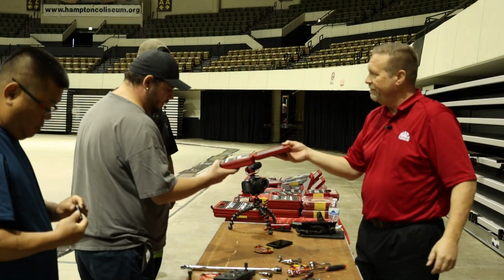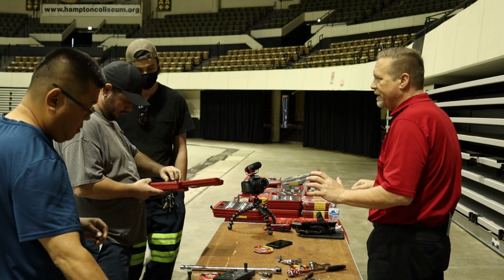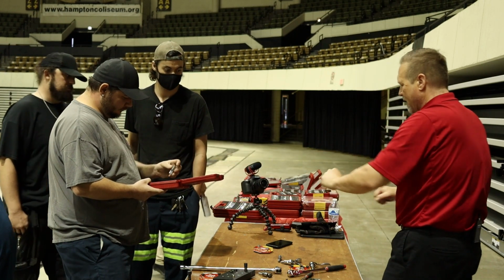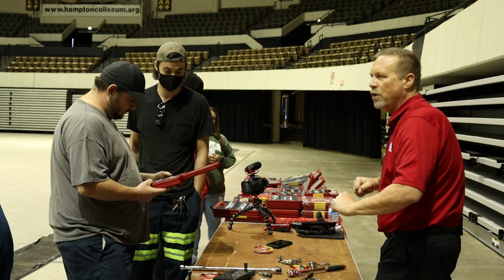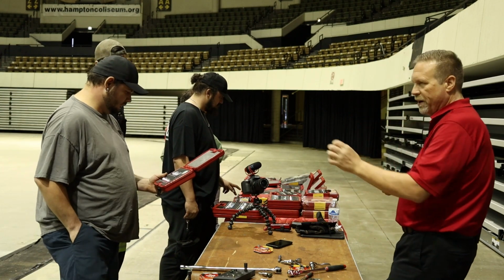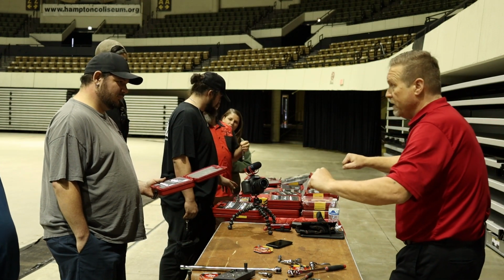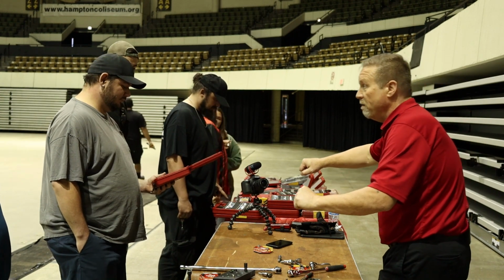Have Torx Plus. In fact, I just did a video of a torque wrench with a torque wrench and a Ford bed bolt, a T50. And I took the torque wrench and a standard conventional one and I stripped it. And I put it in a bench vise and I cranked it until it stripped. I got to 126 foot-pounds before it rounded over. I put another brand new bolt in and got my RBRT one. I got to over 104 and my torque wrench zeroed out because it was only a 3/8, right? It could have gone much higher.